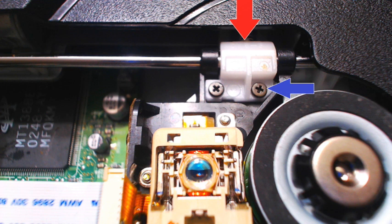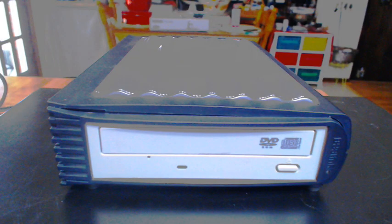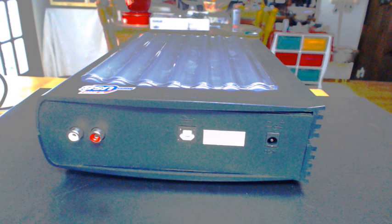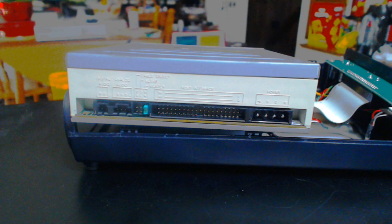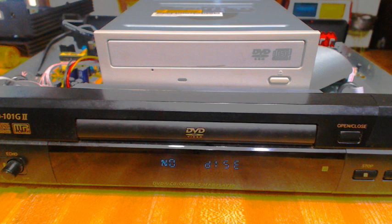So I did a little experimenting. Here's what I found: the existing drive is a pure IDE drive, which is the now-obsolete standard before they went to SATA drives. I'm the guy that keeps all the old junk around because I might need it — and in this case, it turned out to be correct. This is an external DVD drive; it is an IDE drive with a converter attached to the back to convert it to USB. I went through the I-wonder-if scenario — I unhooked the back of the existing CAVS drive and plugged it into the back of this drive after I took it out of the case. Sure enough, it worked. The karaoke played just fine using this new drive.